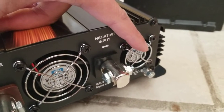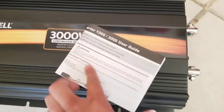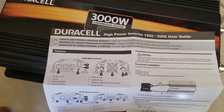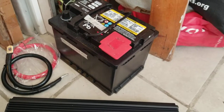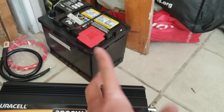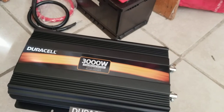For 12-volt devices I can ground it to the car chassis. The Chevy Volt is interesting — it does a DC-to-DC conversion from the traction battery, which holds about 17 to 18 kilowatt hours, to the 12-volt system at roughly 1000 to 1500 watts. I'm also thinking about using this for my solar project with golf cart batteries or old Chevy Volt batteries as a powerwall, inverting with a 3000 watt inverter to power my household or garage.